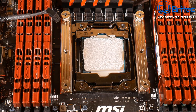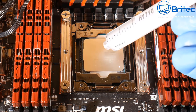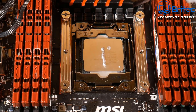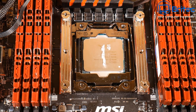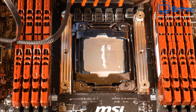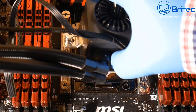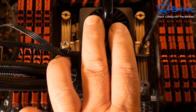With the line method, whichever way you do it - vertical or horizontal - there's normally a little gap down the outsides. I'll try and do a straight line with this applicator here. It's not the best, it needed a nice thin nozzle. I'll just add a little bit more at the end to make it even - there we go. I've cleaned it all off and we'll put some pressure on by tightening it down. You'll see how different these compounds react to pressure when you screw these down.